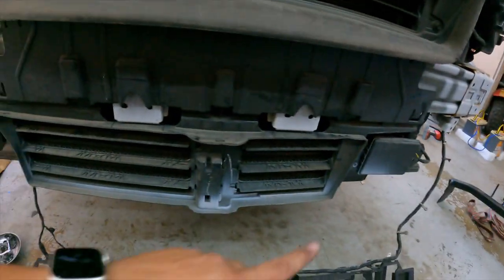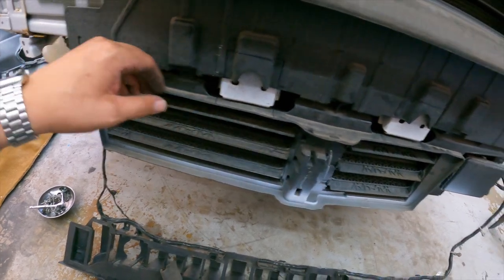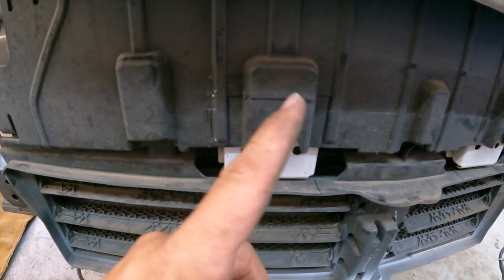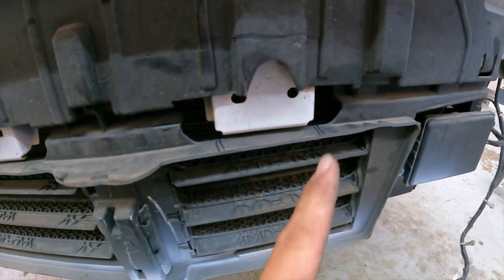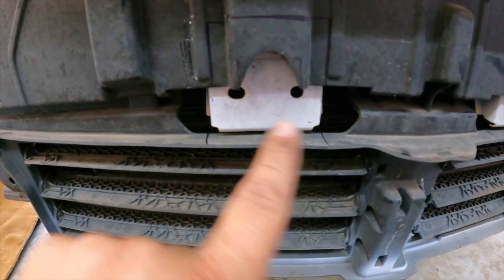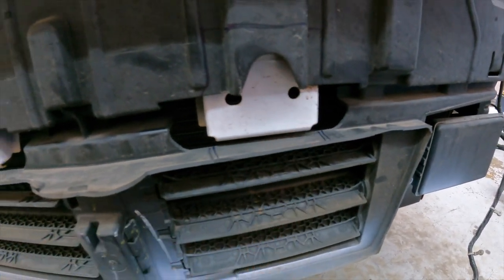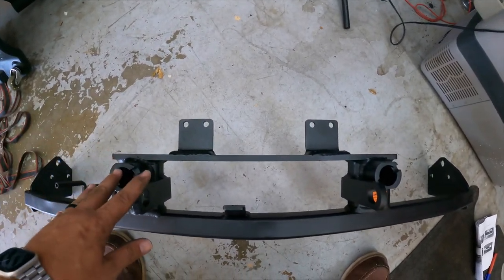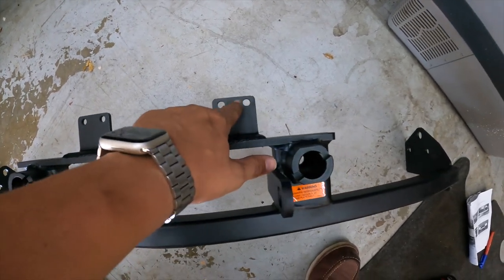We're on the next step. You're only supposed to remove the bottom and the sides of the shutters — I ended up cutting the top too, but not a big deal. You've got to cut this piece of plastic out on both sides. This is the only piece you'd be cutting out of the shutters. Then you need to take a three-eighths-inch drill bit and drill these four holes out to enlarge them so you can bolt everything up. Looking at the base plate facing down, these are the four holes we're going to bolt up there. I'm going to get that cut and drilled out, then we'll jump up to bolt it on.